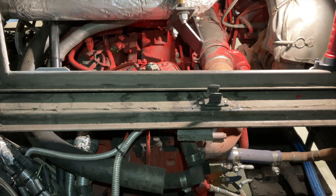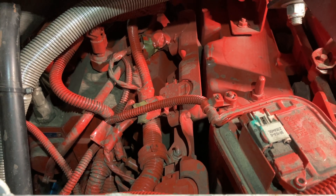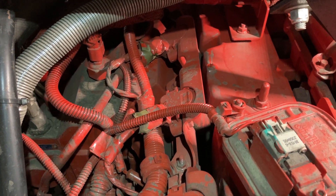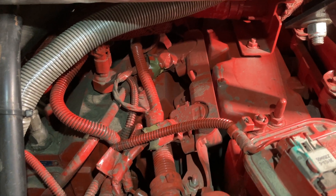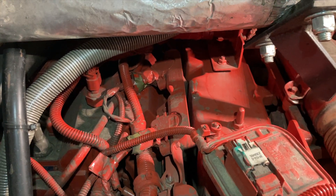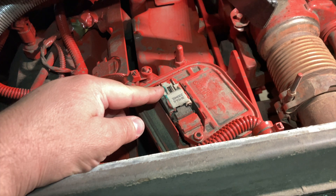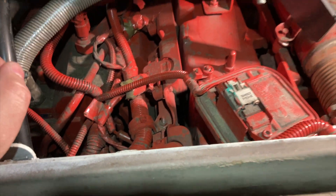Since we are working on a bus, we're in the inside rear to get to cylinders 4, 5, and 6 — pretty much the same procedure. We're going to remove the whole bracket for 4, 5, and 6 as a whole. When reinstalling this one, you do not need to remove number 4 in order for it to fit — it's just pull out and push back in the whole bracket assembly. Everything is just in reverse to put everything back together. You do, however, need to disconnect this sensor right here and move this wire out of the way in order to pull the bracket off.